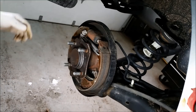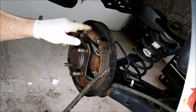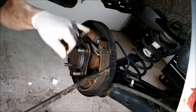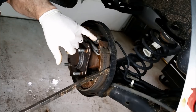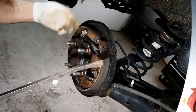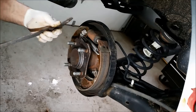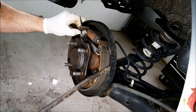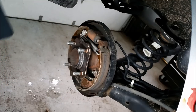The first thing I want to check is to make sure the wheel cylinder isn't frozen. It's not terribly common — or uncommon — it happens. You get one or both sides of this wheel cylinder: there are two independent pistons inside that push out and come back in. It's not unheard of to have one or both sides jam up where it's only pushing one side out and one shoe does nothing. So I just get behind here and give it a little movement — I can see that side went in, that side went out. Give it a push back, make sure nothing's binding up, kind of like when you compress a brake caliper — you want to make sure it compresses evenly and smoothly. That actually feels pretty good.